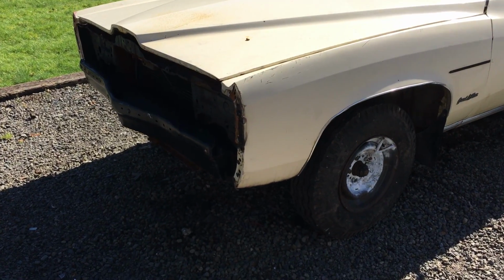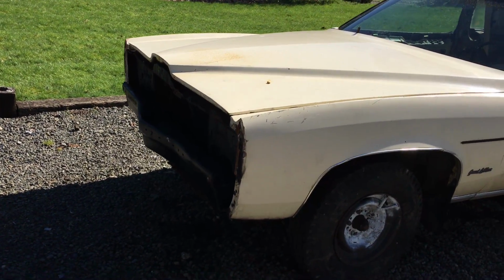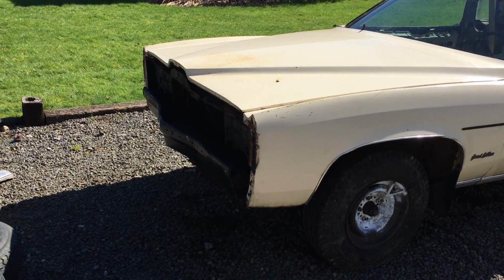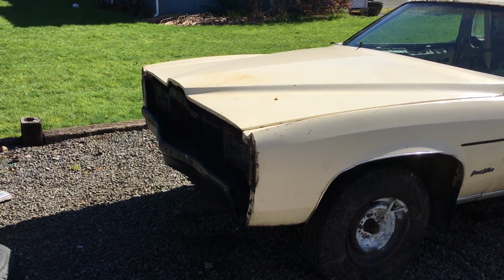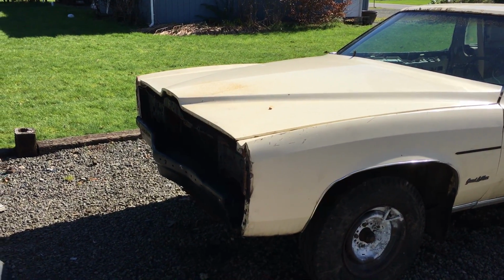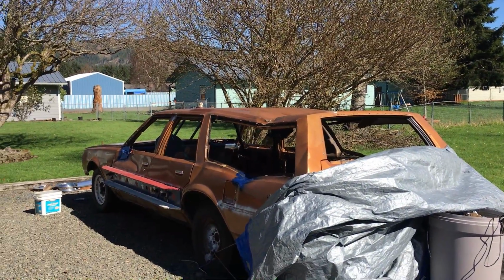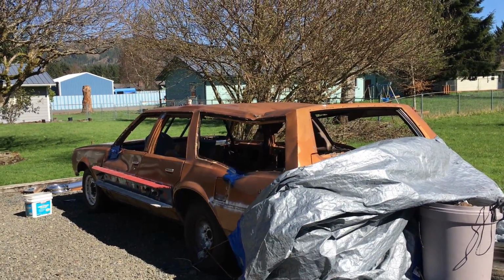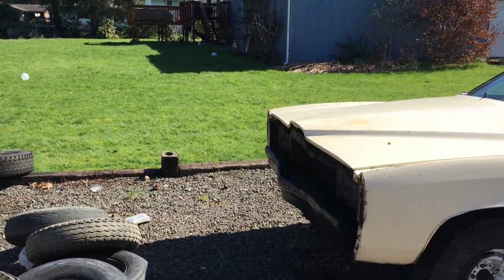I've hard nosed the bumper on this. That is where you shorten the frame by either cutting it or folding it or doing something to where it's a square mount so you can mount the bumper. What this helps do is keep everything together. You can't do something like that on those. It's a chain and go car. You have to hold everything together with chain outside of the 1-inch all thread through the core support. Where this one, you can weld.